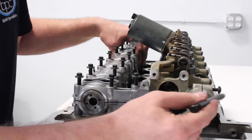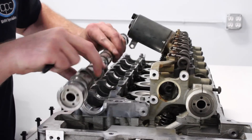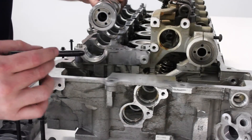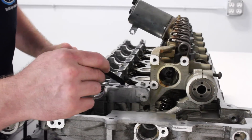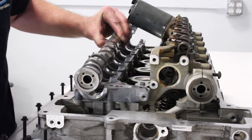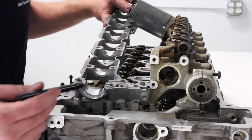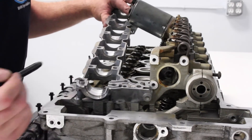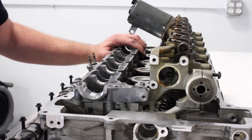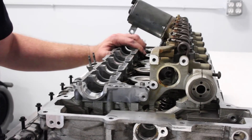What is important on both the exhaust and intake cam is that at the end of each cam there are what look like two piston rings. These piston rings keep oil that comes through these ports inside the channel, allowing oil to flow out into each VANOS gear. Vehicles that don't have properly maintained oil changes will have these rings cut into the bearing ledge, allowing oil to bleed past, which drops pressure and throws a fault because the VANOS did not reach its end stop position as requested by the DME.